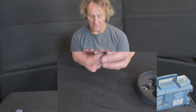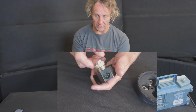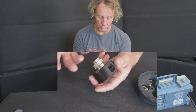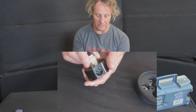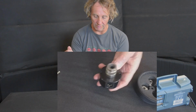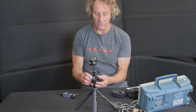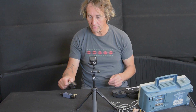This will come in handy if you have a bunch of in-ears and you want to make sure they all work properly, to see if any of them are blown or there's wax or water or something. Check the response, hook up Smaart or an analyzer, grab all your ears, plug them all into a pink noise generator, and then boom, boom, boom, you can whip through a whole pile of in-ears and make sure they're all working well, or troubleshoot why the band threw something at you at the last gig.